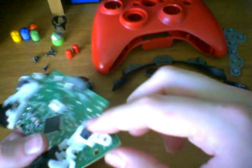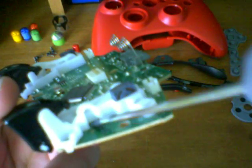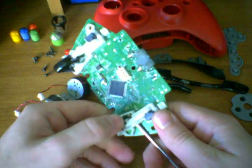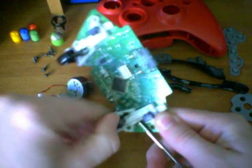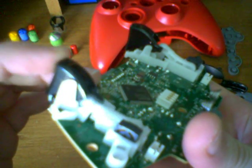To reconnect the long white piece to the trigger, we're going to take a small screwdriver and stick it in this little arc here. There we go. You'll notice that it's underneath the little white piece. Now we're going to push up on the screwdriver so that the white piece rises as we push away on the 360 trigger. And there you go — the white piece is now reconnected to the trigger.